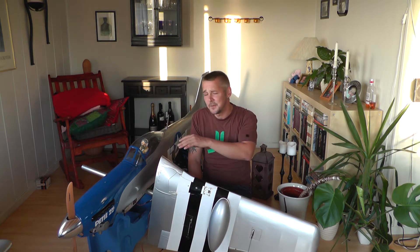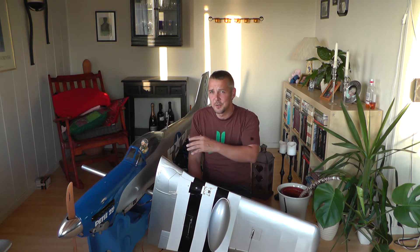After getting this P51 Mustang from Phoenix I had my first experience with air retracts. That didn't work out too well because I had no experience, so I had major leaks especially with the quick connectors from the wing to the fuselage. The problem was mainly using wrong tubes because these connectors were from Robart and this air retract system is not Robart, so the tube sizes were quite different.